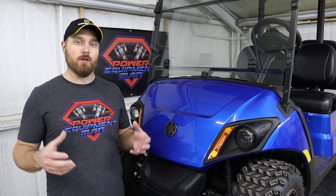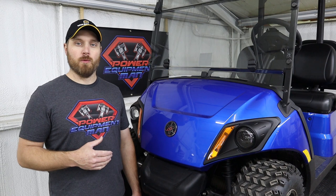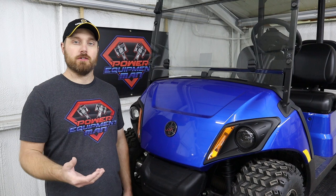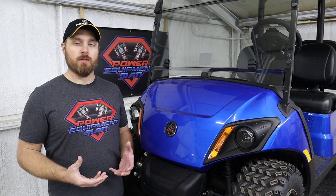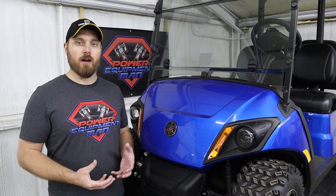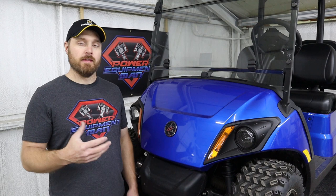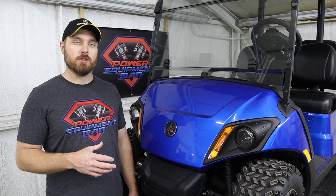There's a lot of controversy about whether to service the engine and do your oil change before you put the machine away for the winter, or if it's better to wait until spring. For us, it makes more sense to wait until springtime to do that service. Oil is going to break down over time — basically as soon as you put that oil in the engine and it gets run, it starts getting contaminated with fuel and starts breaking down. So we like to wait until springtime to put that fresh oil in, and then it doesn't start breaking down until you're starting to use the cart. We wait until February or early March, right before we're ready to start using these machines, to get them serviced up and then they're good to go for the summer.